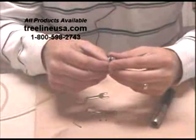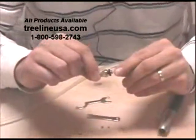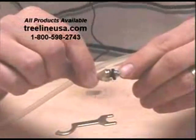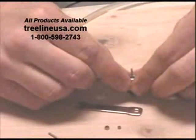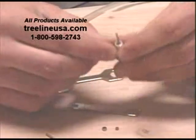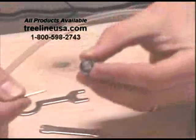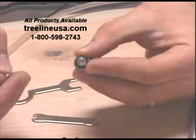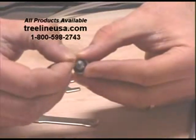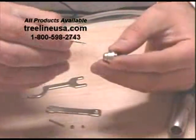Next, I need to take the bit out now. Notice on the back, this area right here is extended out. You turn that flat on its back like this, push straight down, and that will release the bit. Next, we'll use the back end of the bit, and notice that little circle right there in the middle. I'll take and push the bit into it, and by doing that, we'll remove the collet.